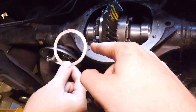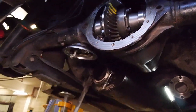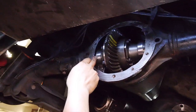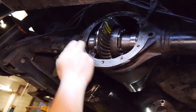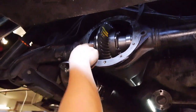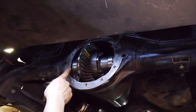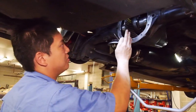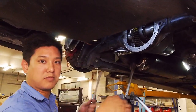We have the shim that we took out of the pinion, which is roughly the right size to use here. So we take half a mil off that and replace it on the other side. The combination of this spacer and this spacer is correct to give us the right preload for this bearing assembly. So if we take half a mil off there and replace it with half a mil spacer here, that will move the ring gear away from the pinion and then we can check it.